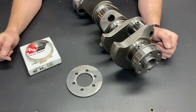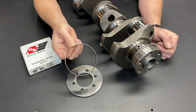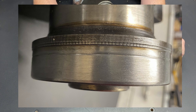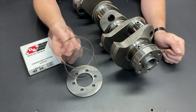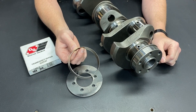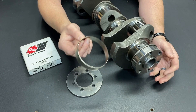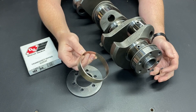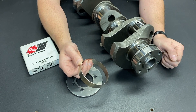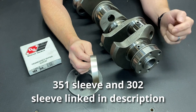I have a technique to keep your rear main seal from leaking. This right here is a crankshaft repair sleeve. It's designed to slip over the end of the crankshaft and repair any grooves there so that your rear main seal doesn't leak. Now you may be looking at it going, there's no groove in the end of this — there's no reason to put this on. But there is. Installing this does two things: it creates a wear surface that can be removed down the line, and this thin piece of steel creates just a little bit of extra pressure between the crankshaft and the seal, helping tighten things up so it does not leak. For the 13 bucks I paid for this, I can't see any reason not to install one, even on a fresh build.